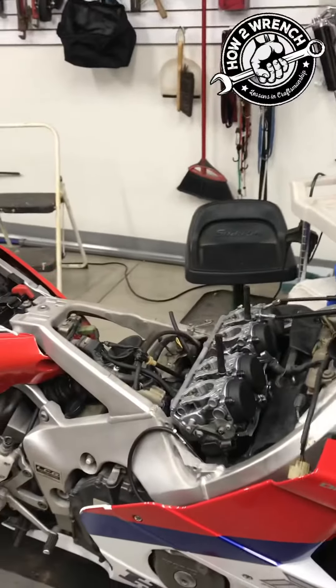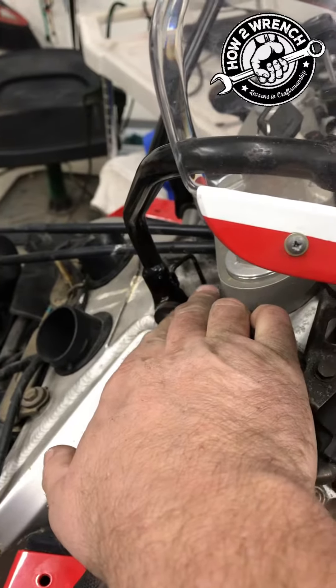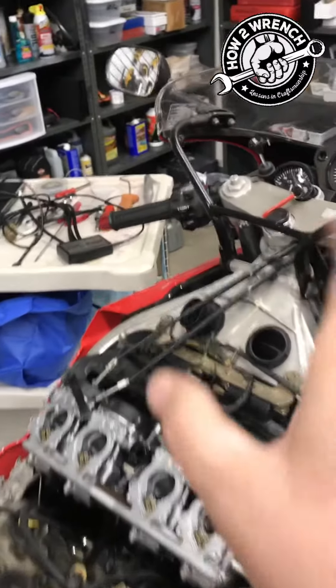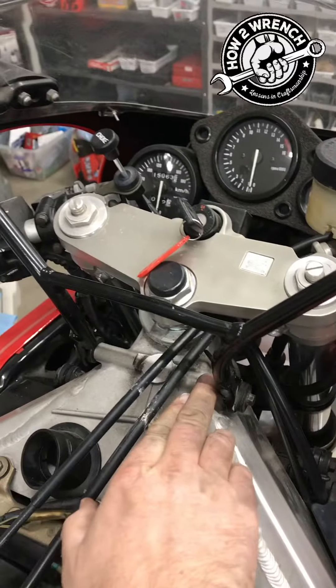But now I'm really at the final stages here, and I'm noticing that throttle cables weren't ran through the bracket. That bracket is meant to route those cables for safety, so that they don't rub on something prematurely — especially on a motorcycle where we're turning that front end back and forth. Those cables sit and move around, and the bracket keeps them in that space to be routed correctly.